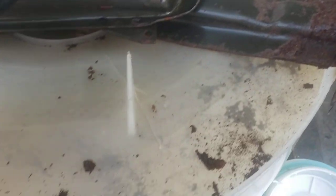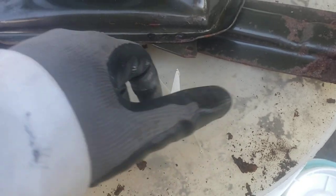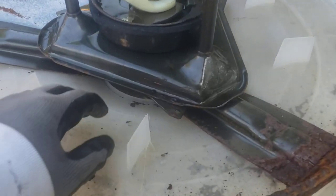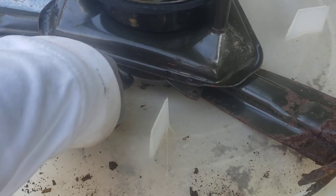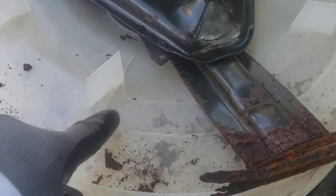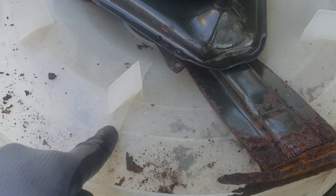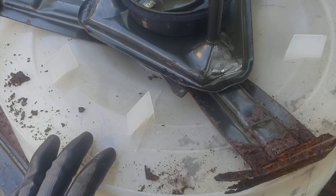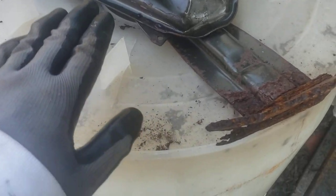Good thing I didn't put more time into it, because I noticed this crack — you can see it right under the tub. These cracks are very common. If you ever have a Whirlpool washer that's leaking, rarely will it come from the middle as a tub seal issue — that happens but it's rare. A lot of times these tubs crack, especially if you're rough with them or slam them off a truck.